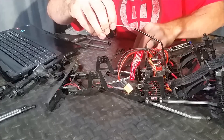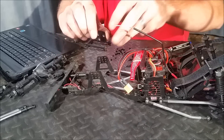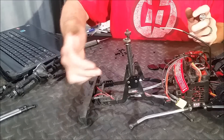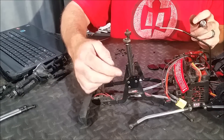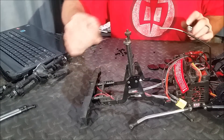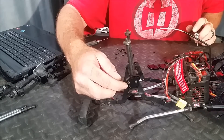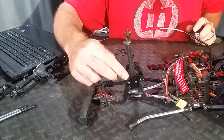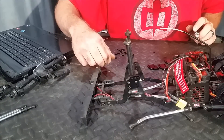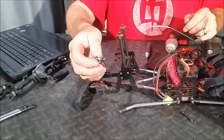Once you have that cross member out, we're going to take our new mount and put three screws in it — the top two holes as well as one of the lower holes. Each one of these is an M3 by 10 millimeter screw. One thing I want to make sure I mention: when you do this installation, in order to be able to reinstall your body mount, you do need to deviate slightly from the instructions. Instead of using a nut on the backside of these two screws, make sure those screw directly into the backside of this mount, and then just use the nut to retain the forward screw. As long as you do that, everything will go in perfectly. Once these mounts are installed, now we can put our shocks on.